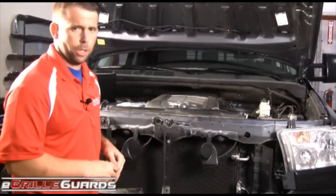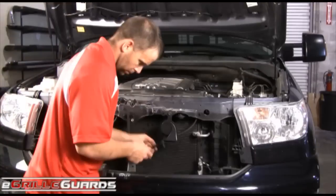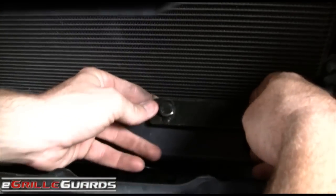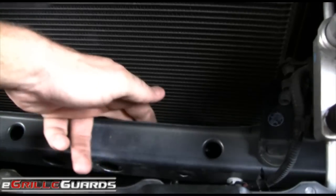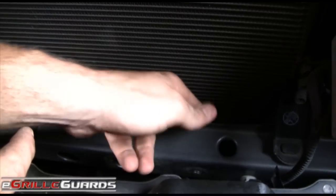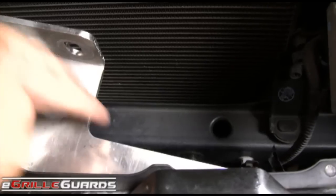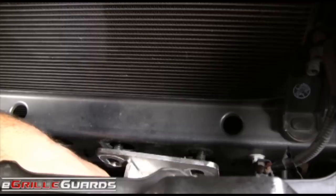Now that we've got both of the main brackets down below done, we're going to move to the support bracket on the driver's side, first starting with the double bolt plate. When installing this, you want to make sure that your bolts are facing down on the side of that square tubing, and then by doing that, you're just going to roll it under so that it actually misses the radiator. Then you're going to use the big hole on one side, and there's just a little hole just big enough for the bolt to go through on the other side. You're going to grab your bracket and go down in, make sure that this part is actually facing down, and it's just going to slide right on.